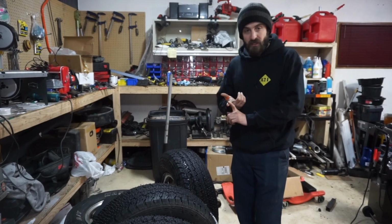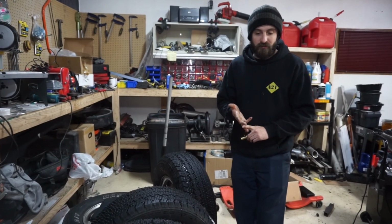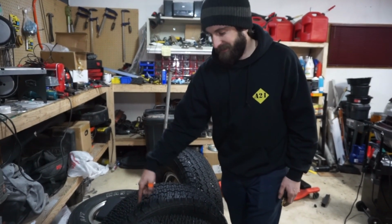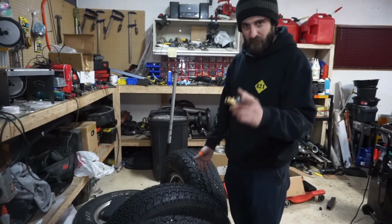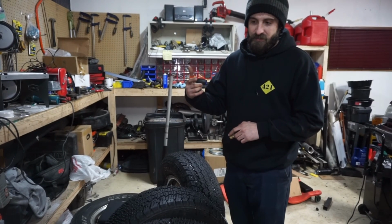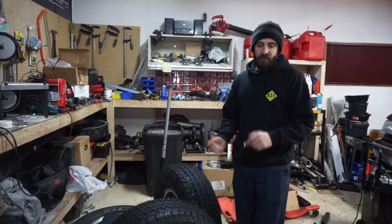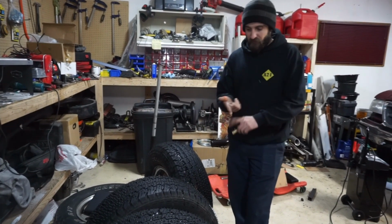So we did some two-wheel drive pulls, four-wheel drive pulls, ripped up my intercooler coupler because I turned too far. The screws actually dug into the coupler and the piping and shredded up my piping. So the tires are fine, the piping is not. I was at like 10 or 11 pounds, and then it was like 8 pounds, then it was like 6 pounds, because every time I would do a pull, it would rip the coupler more, and I was turning and ripping it up. So I gotta get a new coupler, but the tires are fine.